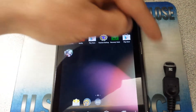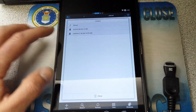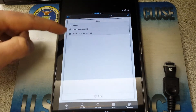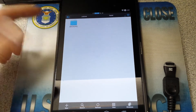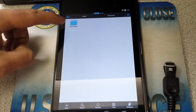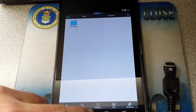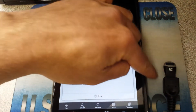One quick thing about this external SD card. When you go to the file explorer, it's going to show up. You'll see your external. I had to create a folder called TWRP — Team Win Recovery Project — and inside that, another folder called Backups. This right here generated what I did in my Nandroid. In other words, it's identical to what it'll look like when you do a Nandroid backup through the Team Win Recovery Project on my external SD.